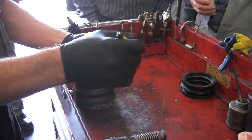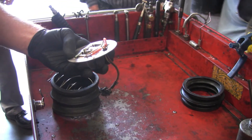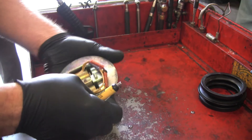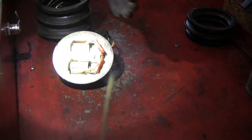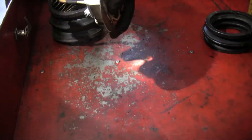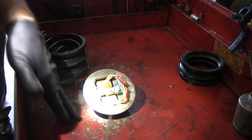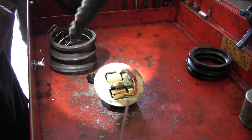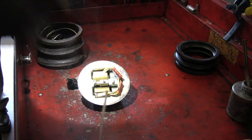It's got these two vacuum valves. They have three wires and they share a ground — they ground through each other. In these vacuum valves, they're spring-loaded to close. One goes to the vacuum intake. You have suction on here, so they keep that closed when not in use so you don't have a vacuum leak and it doesn't operate.